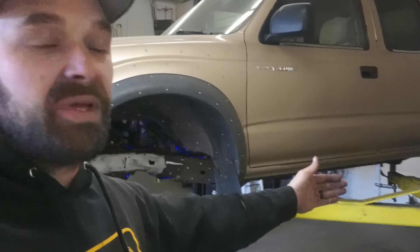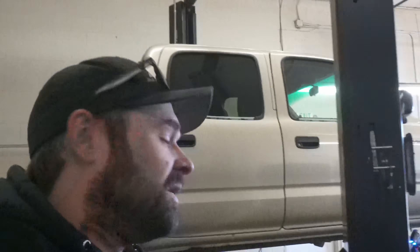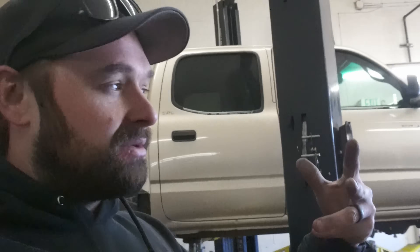After putting about 200 of these little scanning dots all over the truck, we're going to scan the front half to about the transfer case area first - getting the inner fender wells, all the drivetrain, everything - so that when we model the axles into our scan we can know our clearances for sure. The front half is going to be a lot more work to scan than the back because obviously the back is just a bare frame. Once the front's done, we'll move all the targets, stickers, and magnets to the back of the truck, scan the rear, then put the two scans together into one complete scan.